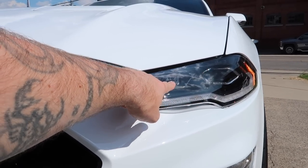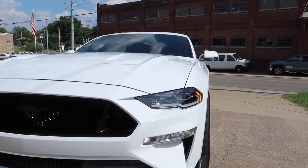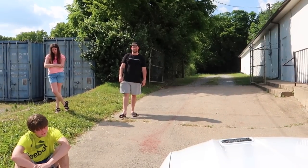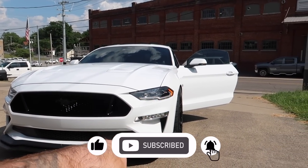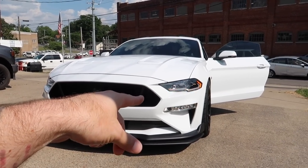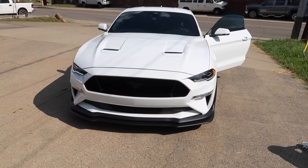This one lights up during the day and is supposed to be brighter with a better cutoff and beam than the regular lights. The best part — check this out — it's got switchbacks, sequential turn signals. If you have the Diode Dynamics smaller unit down there, it'll actually be sequential as well. For installation tip: if you don't want the top DRL to be sequential, you don't have to hook up that yellow wire. We wanted the full experience, so this is how it looks.